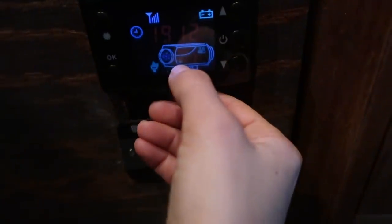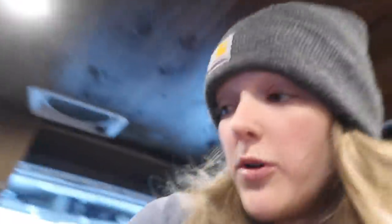My pump just turned on, which is a good thing — it's making noise. Something I did not get on camera that's really important: the first time you turn on your heater you need to prime the pump. To prime the pump, press OK and the down button at the same time. You'll see 'H off' flashing — once that's flashing, simply press the up button and it's going to say 'H on.' You're going to hear the pump starting to tick and the fuel will slowly work its way through the line. When it's ready, either it's going to shut off or you'll see the fuel going all the way through. Then press the on button to get it started. The pump is working — it's starting to warm up. The little bars are all the way up so it's full blast heat right now.